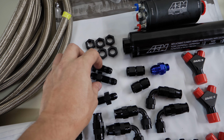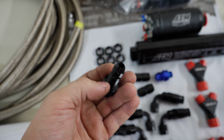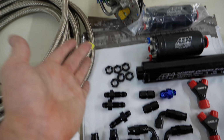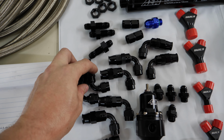They're all aluminum. Obviously I'm going to have to do probably some sort of brushing to get this to aluminum status. And on the inside, of course, the nuts to hold them in there as well. But it's going to be welded, so that way I can pass through the bulkhead with liquid tight. There's no liquid that's going to come out of it other than inside of this line. So we'll have two 6AN lines coming out of the tank. They'll both go directly vertical, because on the car, the tire is actually right past that. So we'll have two lines going up vertical.